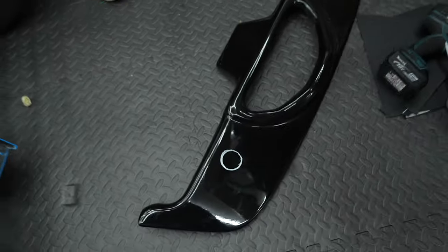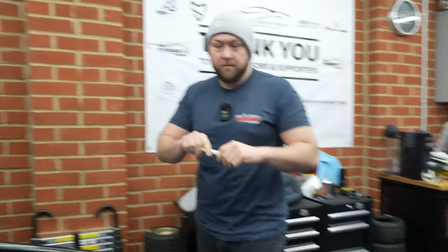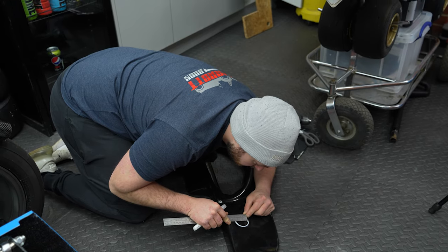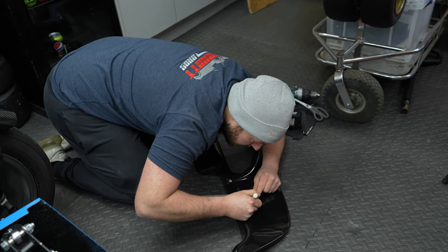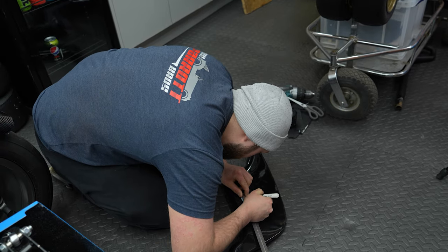That is it. Looks awfully low down, doesn't it? Well, yeah, but the column's not exactly at the top. The column is quite a way down. Okie dokie, so where is my ruler? It is in the bag over there. We've got my set square in that bag. So we're saying internal to internal is 45mm, so 22.5 with a 5mm pen. And then hopefully, because it's a circle, it'll be the same. Yeah, that works well.